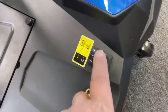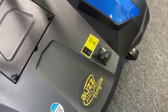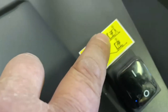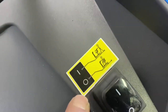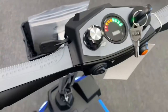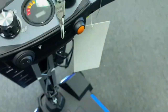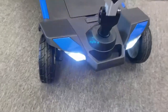Make sure your freewheel brake lever is in the drive position, which is the bottom position meaning drive, and the top one is freewheel. You can see the little stick figures — one pushing the cart and one riding it. To ride, it must be in the drive position. Come to the top tiller and turn your key on — your power gauge is showing full. Your horn works. Your lights: these are your LED path lights, nice and bright. Very similar to the Jazzy ZT zero turn 8 — I think they've kind of copied that a little bit.